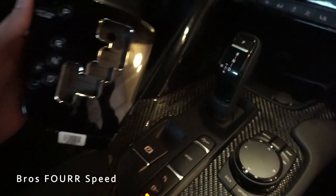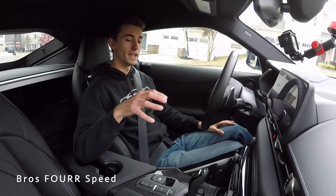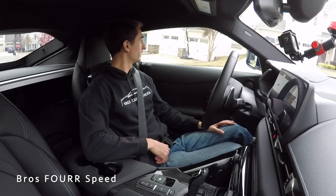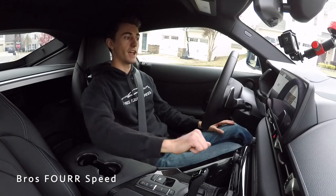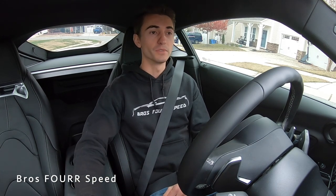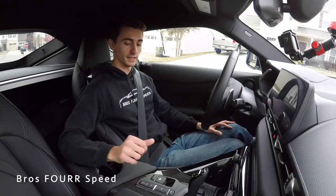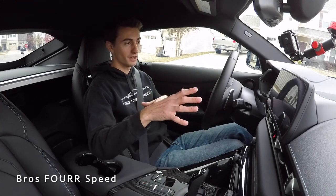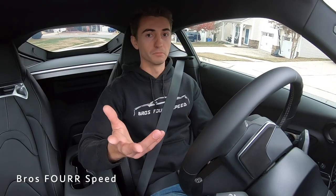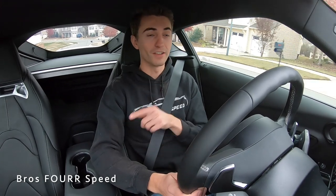On normal transmissions — like the one I had in my Hyundai Genesis Coupe or my brother's Toyota Tacoma — if you park on the transmission and it rolls back, going back into drive requires pulling it really hard, it clunks into gear, and it sounds like something's going to break. My recommendation: when you stop on a hill, put it in park, apply the parking brake, then let off the brake. Now the weight of the car is on the parking brake, not on the transmission pin. When you get back in, press the brake, disengage the parking brake, put it into drive — no jerk at all.